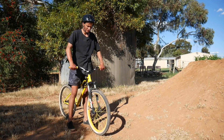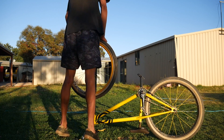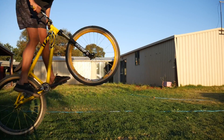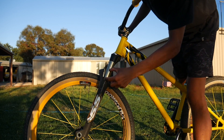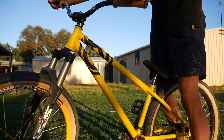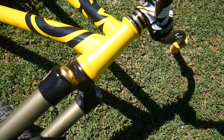I think I just broke something in my fork because there's no rebound now — it won't shoot straight back out. Usually my suspension would only move that much, so it's pretty sketchy. They're also leaking a lot of oil and lost a lot of compression. I usually run them really stiff.